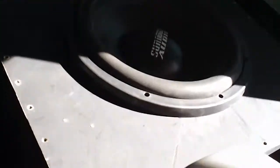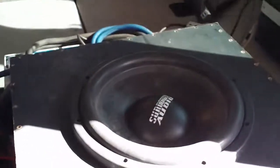We're testing with an SA12 in an old crappy box that we had, just to figure out which way I need to fire my ports. It's sitting at 2 ohm right now — we just clamped it after rise — and the SA is getting a little over 2300 watts, and it takes it like a champ.